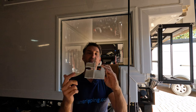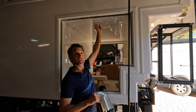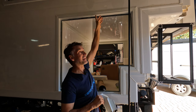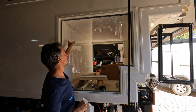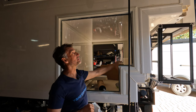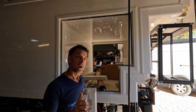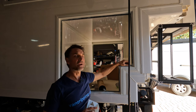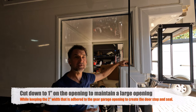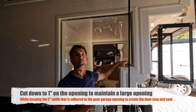Total Composites had a protrusion that accommodates their two-inch panel. This piece is glued right into the bed platform structure, making the whole structure incredibly strong. There's a two-inch panel here and a two-inch panel there; the back panels are three-and-a-quarter-inch panels and the sides are two-inch. It's an incredibly strong little box with a lot of material all the way around, completely glued together. I then glued in two-by-two-inch extruded fiberglass angles, cut down to one inch on one side — incredibly strong, structural, quarter-inch thickness.